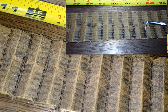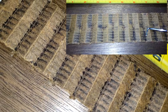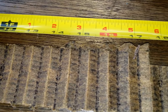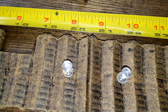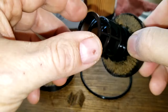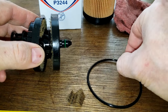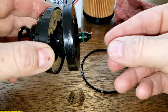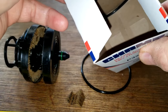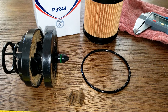The Chevron filter video had a lot more soot in it. This Mobil filter is clean — real clean. Mobil runs a lot cleaner, though the Chevron is a semi-synthetic and this is full synthetic. Looking at the filter components: the end caps are plastic, there's an O-ring — they give you a new one, you just toss the old one. The green one also comes with it, and as you can see in the box, there's a new one included. The filter did a pretty good job.